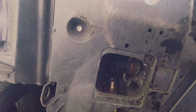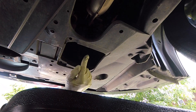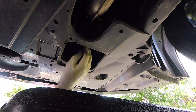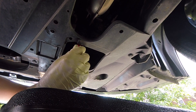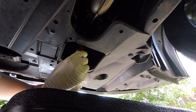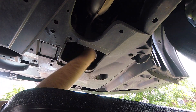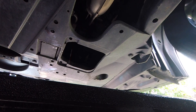Up in there is the oil filter — let's go ahead and remove it. Here we have a different camera angle looking toward the front of the car, and this is where the oil filter is. The way it's situated, this is really the only type of oil filter wrench that will work — the cap-style ones cannot clear the very top of it because the engine block is just kind of in the way. I'm going to grab the filter with the wrench. Now it's turning. There's unfortunately not very much room to turn it with the wrench, but once you get it loose enough you can do the rest by hand. It's starting to drip, so move your catch can accordingly.